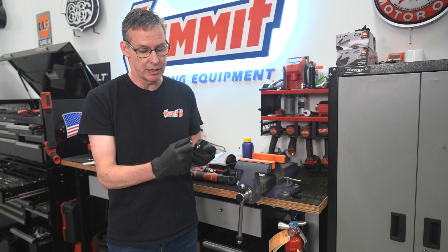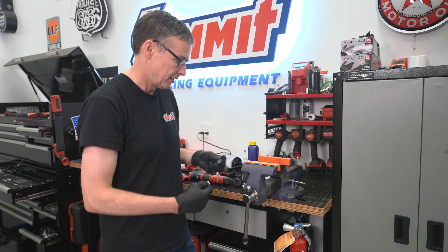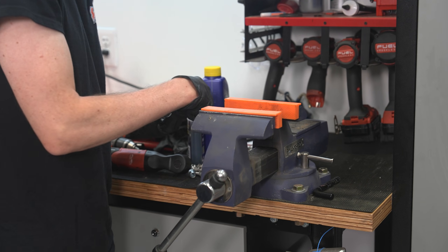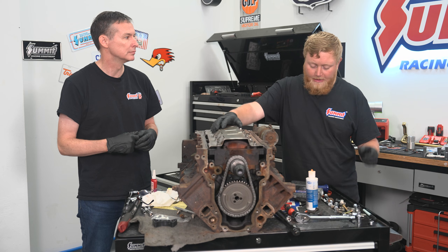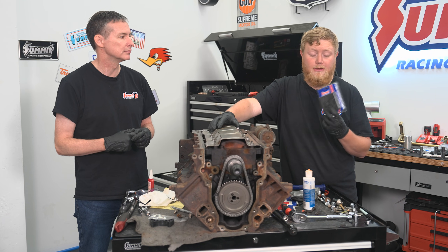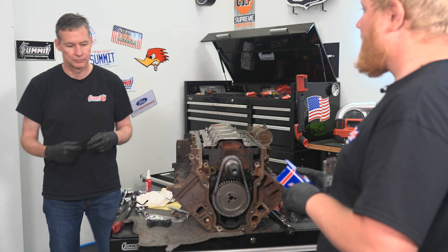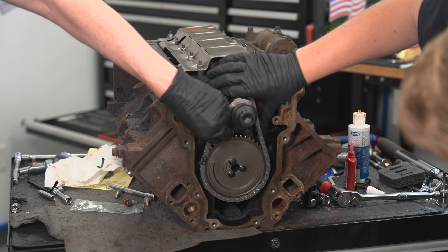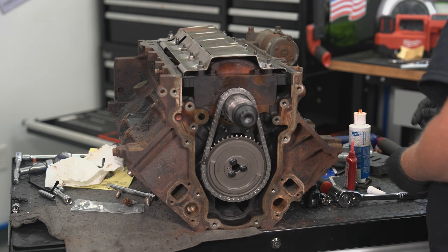With the Trick Flow damper adapter, we need to press out the metal bushings - they're incompatible with the rest of the kit. It's pretty simple: 11mm bolt, a bigger socket, a bench vise - life is good. The bushings are out and it's going to go perfect. Brian got our W-block ready. I'm going to get our cam gear bolted on with Summit Pro-LS cam bolts - we like to replace them every time we put a new cam and cam gear on. Even without the W-block, that chain is tight. That is not some cheap off-brand - that's a very, very nice timing chain.